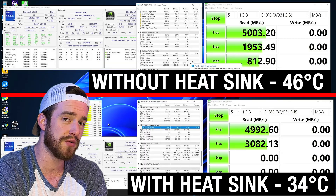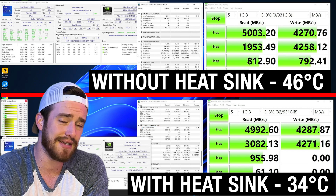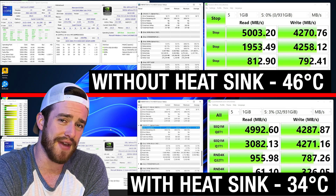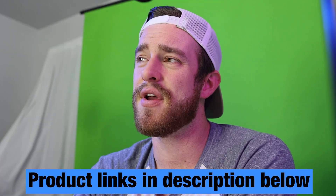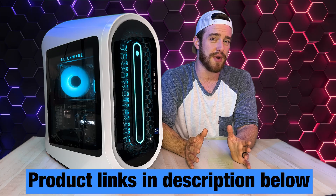So these were the results with and without the heatsink. Honestly, after doing all this, the heatsink doesn't really seem to be worth it for this computer — it's getting enough airflow from the back fans that it never really gets that hot. I'll put a link in the description though for those of you that have cases that don't have very good airflow to your SSD drives, as it's always good to have your drives as cool as possible since that's generally going to lead to it lasting longer.